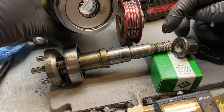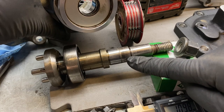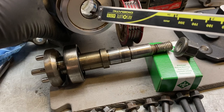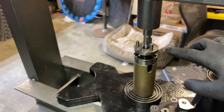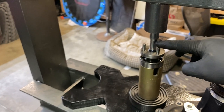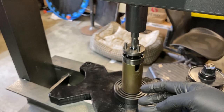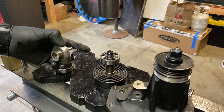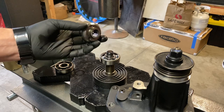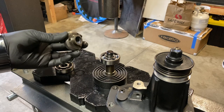A lot of locations on this shaft are hard stops — you press until you meet significant resistance. We want to press off both the bearing and the little plate with the pins. We'll use a press sleeve and a 9-millimeter socket, making sure we have enough room at the bottom for shaft clearance. After pressing off the coupler and bearing, we'll press them right back on. In our previous nose cone rebuild video we pressed both at the same time and got hung up on the splines, so this time we're pressing the bearing on first to better align the splines.